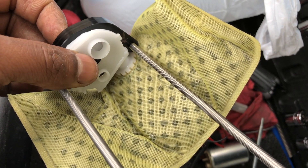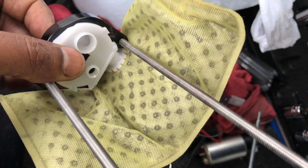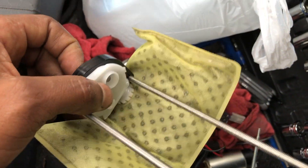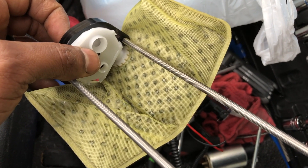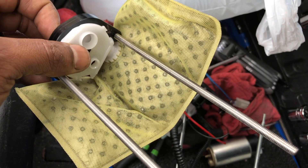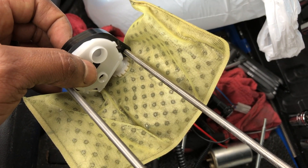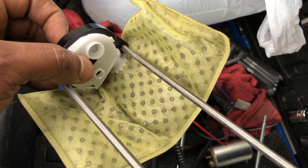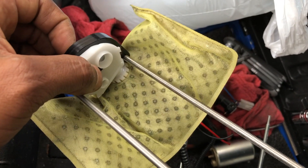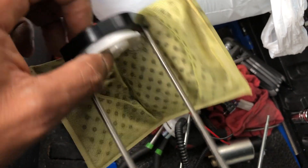You don't want to put a new pump on without the filter, because even though the fuel tank is sealed it's never a guarantee that the stuff inside is clean. The tank always accumulates some dirt because you're putting the pump nozzle in over the years - it accumulates dirt, moisture, whatever. Fuel pretty much cleans it, and the filter catches the rest unless you take the tank out and professionally drain and clean it. There's just enough dirt that could cause problems with the fuel system, which is why you want to filter before the pump. And obviously you've got another filter before the high-pressure fuel pump and fuel injectors.